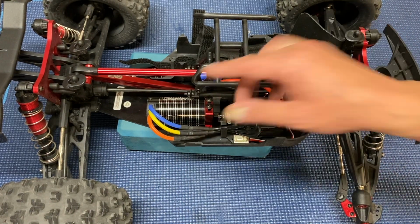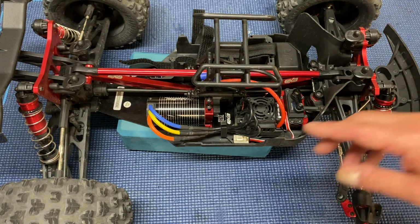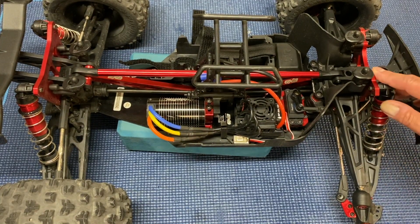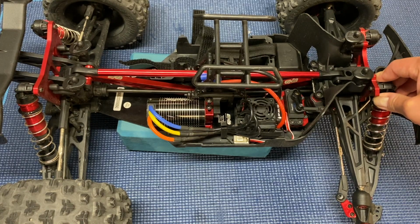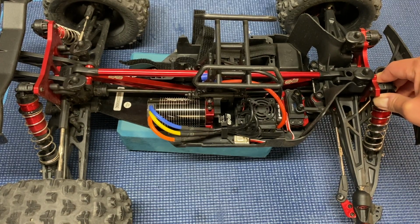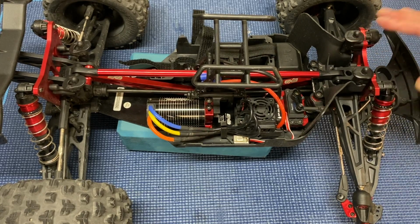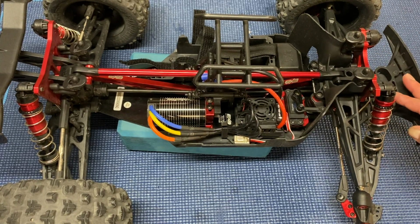And then the rear diff felt super light, basically a lot of free spinning on the back. So I thickened the oil on that. I opened it up and it was about a quarter full. I refilled it with 10K, which is like the stock fluid, and yeah, that ran fine. So other than that, pretty much completely stock, no other extra parts or anything.